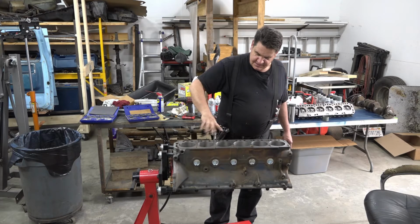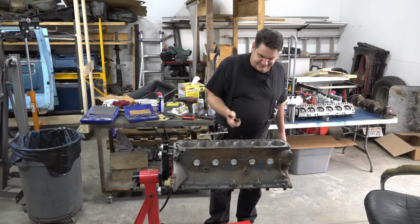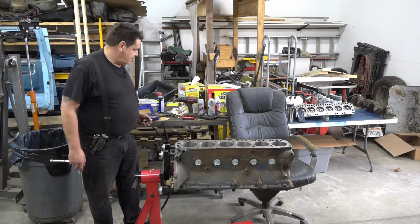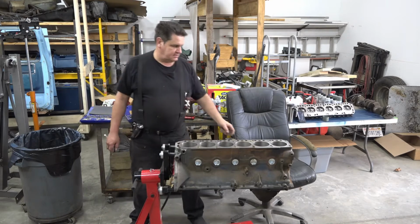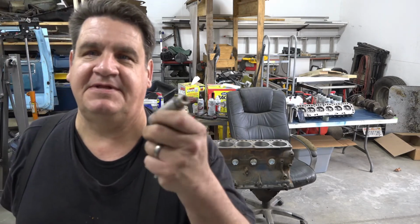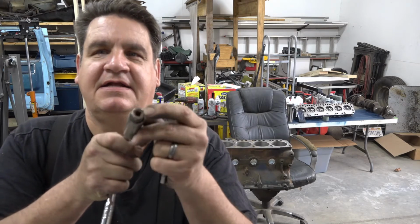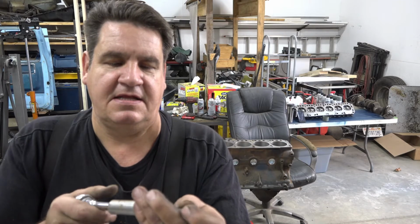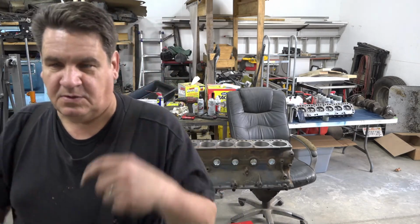And you can see now, this tap just rolls right in there, no problem. And before, when these other holes, it's really fighting you. You have to really put some effort behind it to cut through all that mess. And I'll show you on some places where your T-handle for your tap won't work, say because you're in close to something that sticks out on the motor, then you can always MacGyver yourself up something like this, which is your 3/8 on one side for your socket, and then you run a 1/4 drive socket in backwards, press it into your 3/8 socket, and it'll hold your tap for you. So that'll allow you to get in around someplace where the T-handle won't work because it hits.